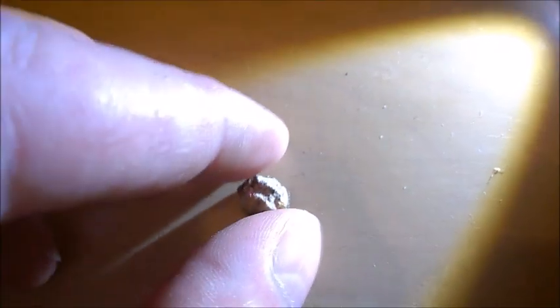It's right above the compressor. There is this hole here and I think it's clogged — it has some dirt on it. Okay, there you go — it was completely clogged. I don't know what happened to be in there. Now I need to obviously wipe off the floor. Be sure to disconnect it first. You see it was clogged — this was what was blocking the outside drain nipple. Very weird, it's like a cap from dirt I guess, but obviously you need to check both ends.